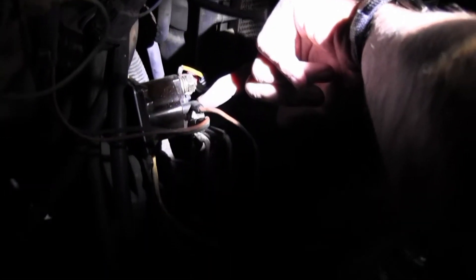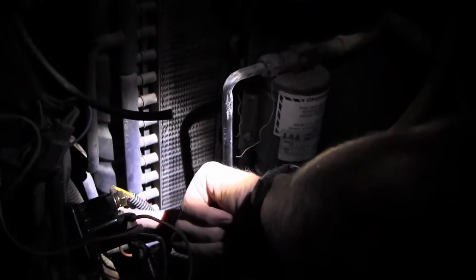I don't know. It's not clicking. It could be a wire, it could be the solenoid, it could be this. But when I test this wire, it's not sending a signal when you crank it. There's one on the other side and it is working. I don't even know what that one does.